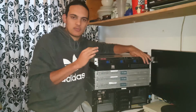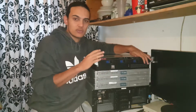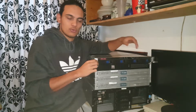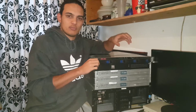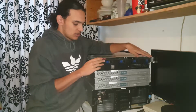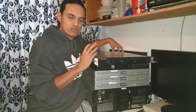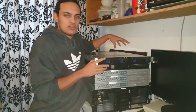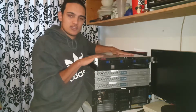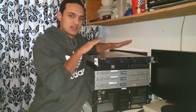But the motherboard I'm looking for specifically needs 5 or 6 SATA ports, because for each drive bay you need 1 SATA port, and then I also want another boot drive and maybe a cache drive as well. And yeah, I think this case is perfect for it. It's 1U. There's already a reasonably good power supply in there, and there's nothing wrong with it. It works perfectly. So at the moment I'm not using it, but I definitely want to make this my dedicated NAS.